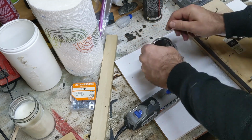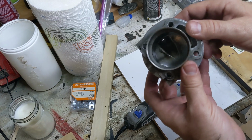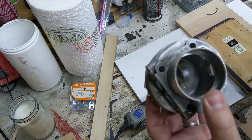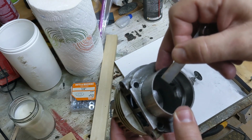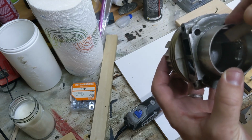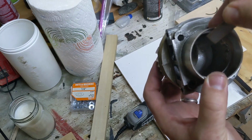And then we'll put it in here and measure it. You can't see this part, but I'm going to put it back over here on this piston to push it in like that. I just pushed it on the motor to push the piston in. So now I've got a little bit more of a gap, and I'm going to take my feeler gauge, which is 8/1000ths. I'm looking to get this thing in there, and it's still not going. Oh, it almost went. It's just about there. I'm just going to barely touch it.